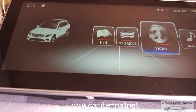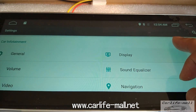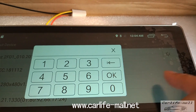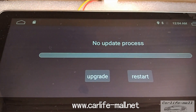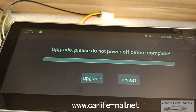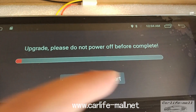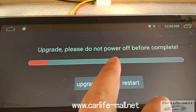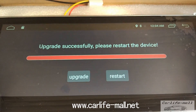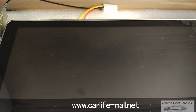Go to the screen again. Click Apps, find Settings, and find the software version. Click the logo at the top right and input 0, 0, then click OK. Click Upgrade. You can see the upgrade running. Don't power off during any upgrading process. This process is very fast — around one minute. Then click Restart to finish.